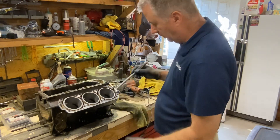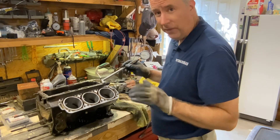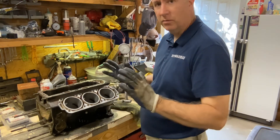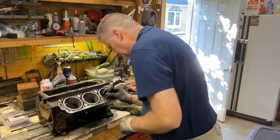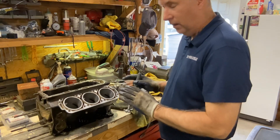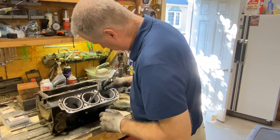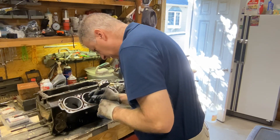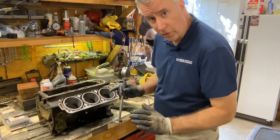Let's go ahead and measure and see how much we got out of the bottom — we'll see the difference from the top. The top on this one is just about a half a thousandths smaller than the piston size; we haven't gone too far yet. We were 2 and a half thousandths smaller inside, and now it's just about 1 thousandths — so we're about a half thousandths difference. I really just took a little bit of material at a time. Let's check the next one: this one's already 1 thousandths over the piston size, and the bottom is exactly 1 thousandths over — so this is perfectly straight right now.